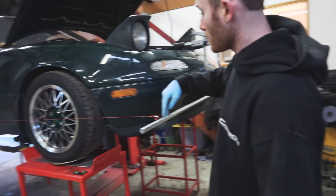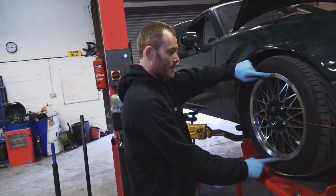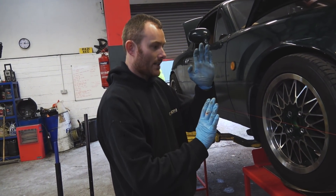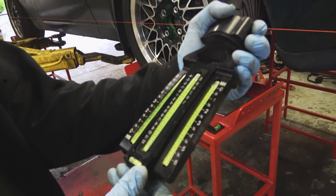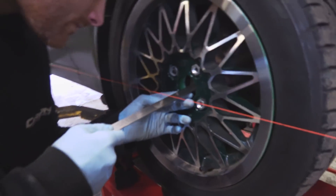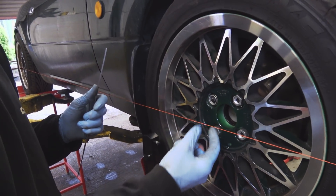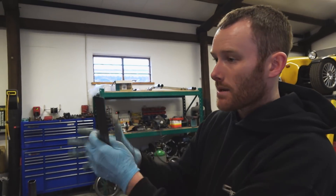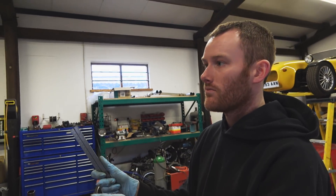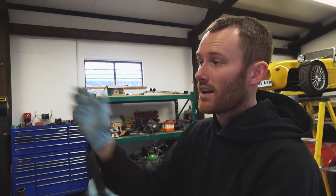With this setup you're going to do things like toe and camber — we've got a different gauge for camber. Basically a metal bar that comes across here with a camber gauge attached to it, and that tells us what the camber is running. Things like caster can also be done — the camber and caster can all be adjusted. A lot of modern garages use the digital setup but string alignments are pretty much what a lot of professional race teams use. We're making sure the string is equal distance from here to the centre of the wheel both sides. The steering wheel clamp is so we can put the steering wheel in exactly a straight position, so when we're doing the adjustments we know we're adjusting it to a straight steering wheel.